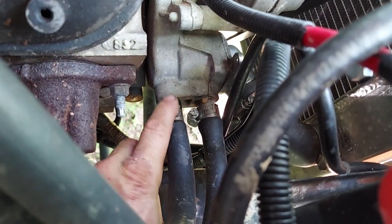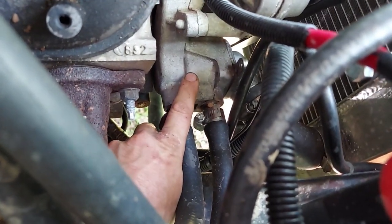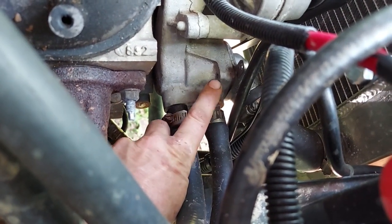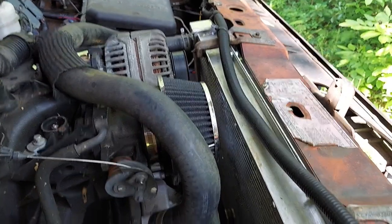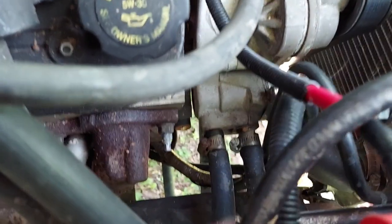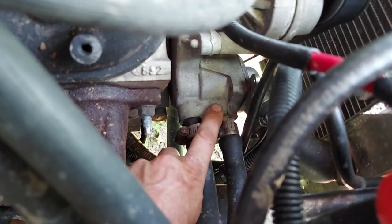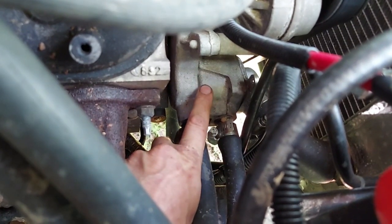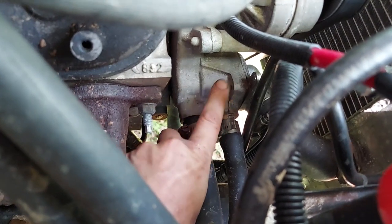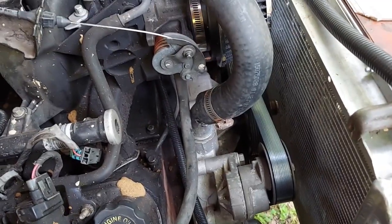What I'm going to do is take the water pump off, tap both these ports, and block them off. I want to put a freeze plug right there like the race car people do, leave the thermostat out so we have continuous flow, and see how she does. I feel like the hot water is overcoming the flow of the cold water trying to come through the thermostat housing. Once I tap and plug those ports and put a freeze plug there, it's only going to suck in cold water.